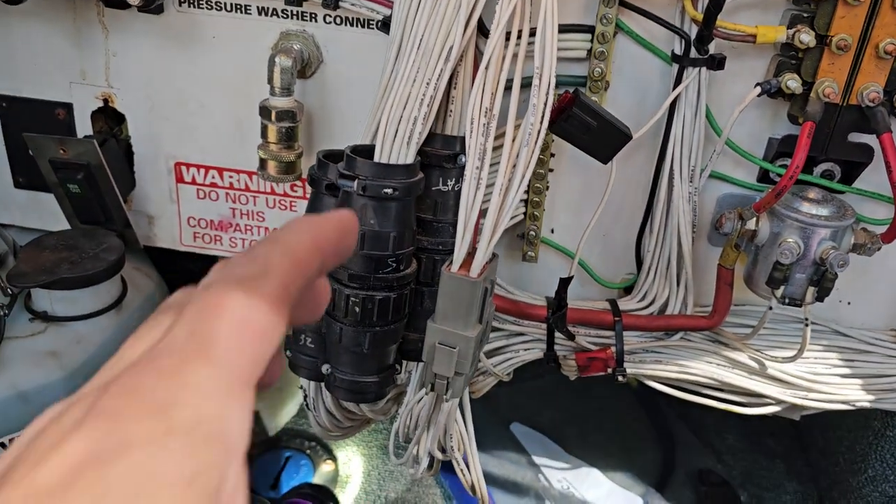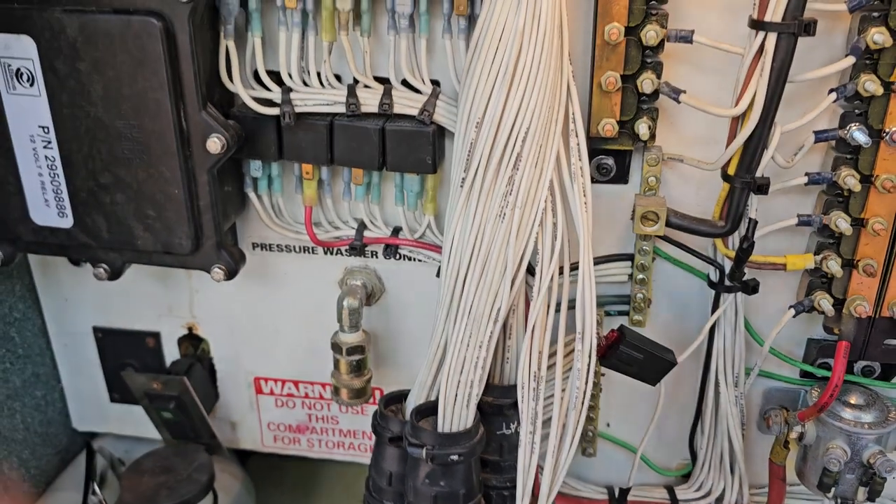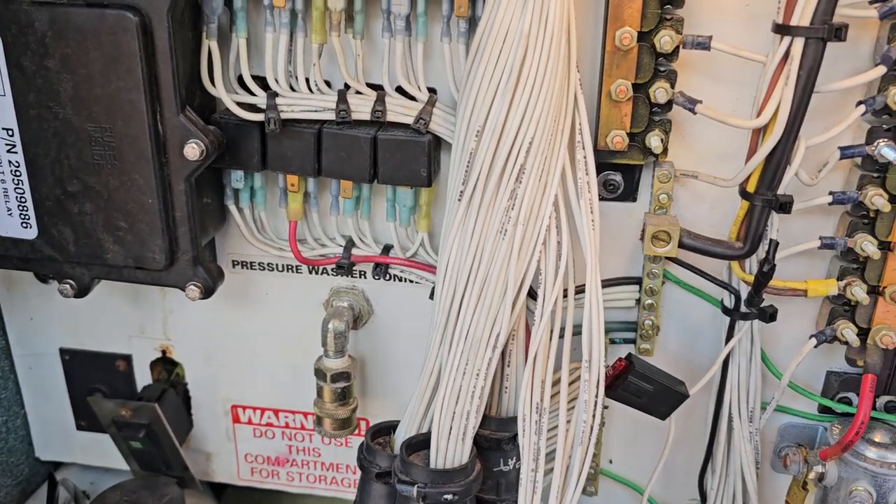I'm getting all these. I'm looking down for the VSS — I've lost my vehicle speed. The actual unit has been tested; I have a pulse generator, a signal generator, and it was working. Plus, when it comes on it does its ding test. It's okay that it's working, but that doesn't mean it's receiving a signal — that's what I'm missing.